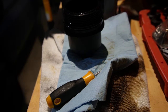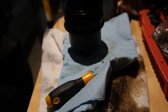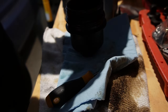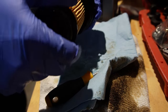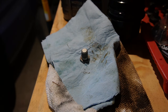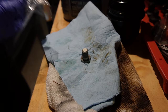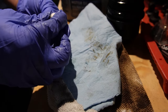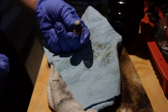We're going to put the new o-ring back into the same groove it came out of. The o-ring is slightly stretchable — just stretch it over the top and guide it into the groove. Whenever you're dealing with any o-ring it's always a good idea to lubricate it. Since this is an oil filter cap, I'm using engine oil to lubricate the large o-ring around the cap. The new oil filter also has three o-rings — lubricate those with engine oil as well — then pop the filter in and give it a light tuck to make sure it's secure. Also replace the old crush washer with the new one from the kit by popping it onto the drain bolt before reinstalling.